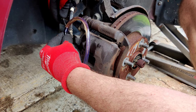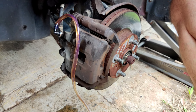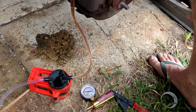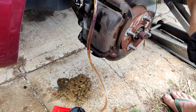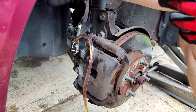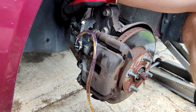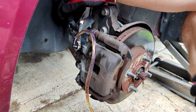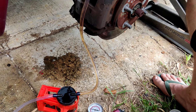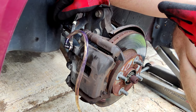Look at that smooth stream — and that's what we were looking for. I've opened it up quite a bit and it's going in fine. The vacuum is pulling down real slow, and again, a nice smooth stream, very few bubbles. I didn't grease the nipple — a lot of people suggested that, and that's another thing you could do — but I didn't have to. Just using that little bit of thread sealant on there basically took care of it. It's a slow process, but you can just watch the fluid clear out. And that's basically it — that's how you get this $20 item working well.